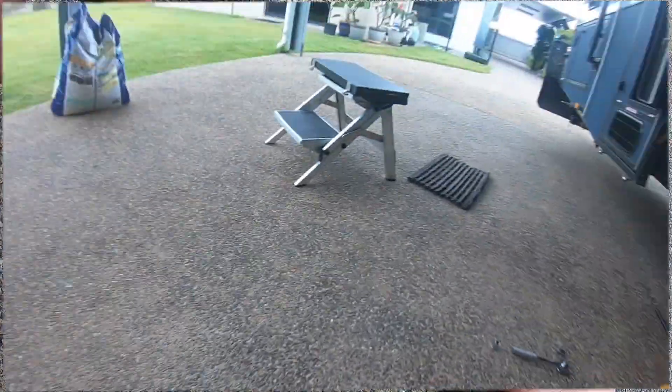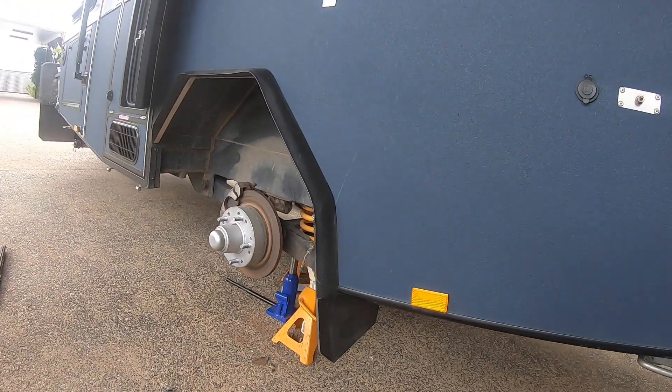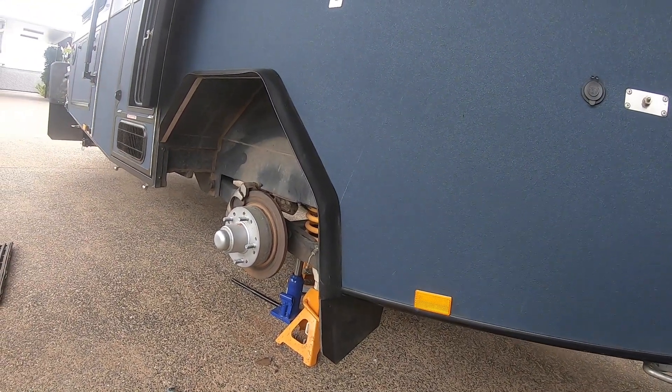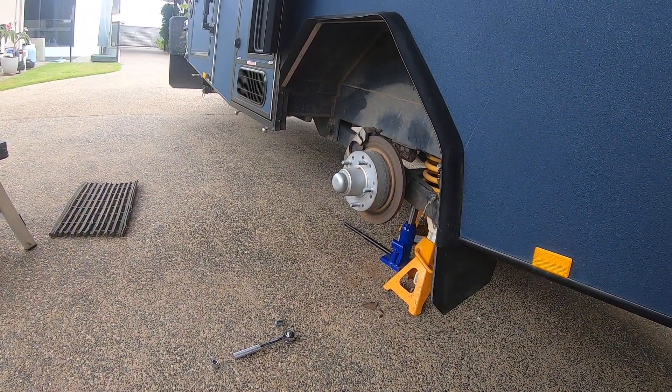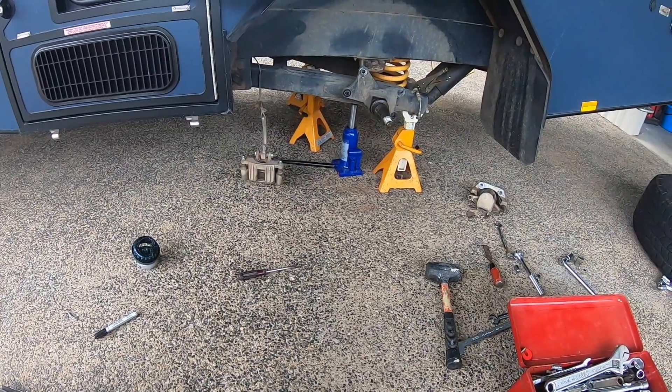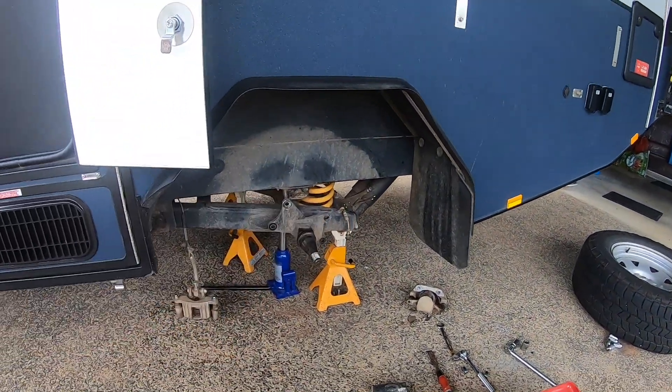Even if it was salvageable you'd need to run a kit through it. The rubber boot on the sliding bolt — that's where the dome nut was missing — has disappeared. You can see the heat marks and the piston. It's just pointless trying to fix that, so I'm just going to get two new calipers. There was obviously a bit of heat in there, so I'm going to pull the discs off as well, check the bearings, and probably get the discs machined.